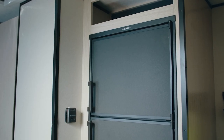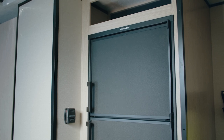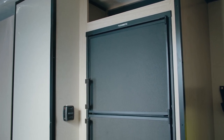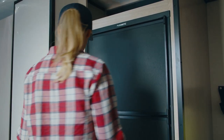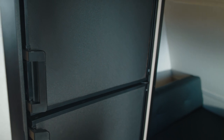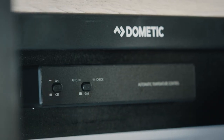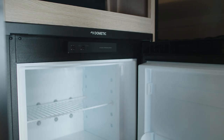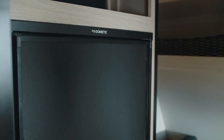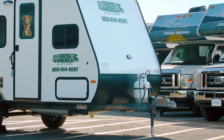This fridge operates a little differently than the one in your house. It takes about eight hours on average to cool down — less when cold outside, more when hot. Just like your stove, it works off LP gas. Keep in mind that it needs to be somewhat level to operate. To turn on your fridge, open the freezer door, press the on/off switch, and wait five seconds. If the check light stays off, your fridge is working. If the check light comes on, go check that your LP tank valve is open.